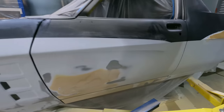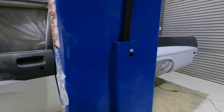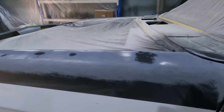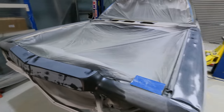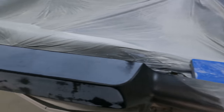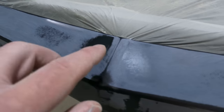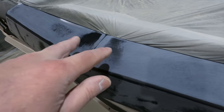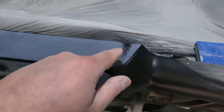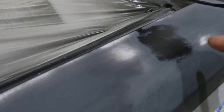I pretty much finished up the bottom section here - it's all done, looks really straight, still got to sand this last bit of bog once it dries. I've put all-you-need on the front here and top half of the guard. I'm going over the block with some 120 grit just to find the low spots - obviously that's a low spot, very slight low spots here, and at the front here there's a couple through there and on top of the guard. There's a very slight one here, one here, and then they get bigger, and that's the aerial hole.